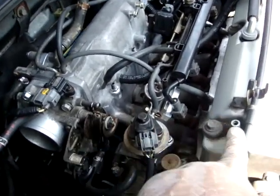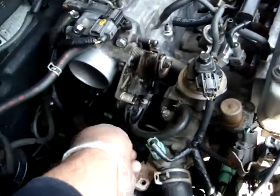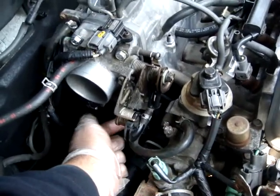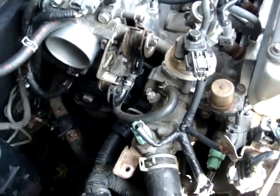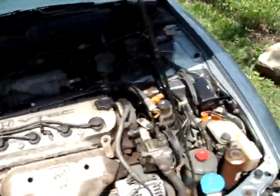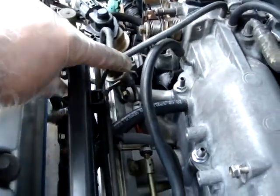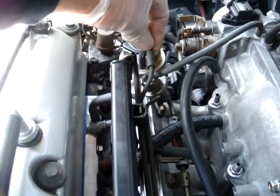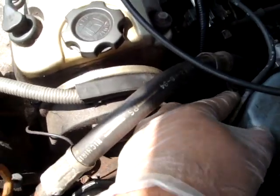What I also did is clean up this vacuum hose that connects to the whole mess here — I took that whole piece out and just jumped the coolant hose from the FITV straight to the thermostat housing. For vacuum connections: EGR goes straight to this nipple here, which is from the B1. I don't know if it's the same for the B2, but follow that EGR line and connect it straight to the top of this.